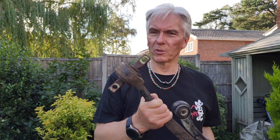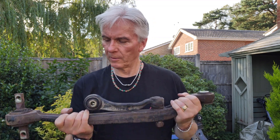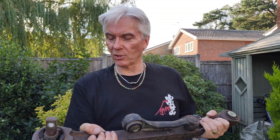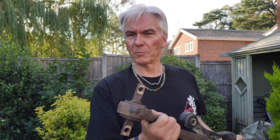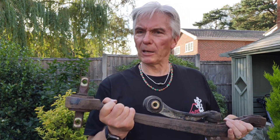Right, I spent a lot of time trying to get that out of the box! These are the other major suspension parts - the trailing arms - that bolt onto the chassis of the car and go onto the hub. The bush is excellent, no problem at all. The bush in the ball joint is fine, the ball joint itself is fine, the boot is still good on it. The only dodgy bit is that it doesn't move, but that's something Lee should be able to press in no problem - it's quite a normal thing to do. They have an alignment mark so you get them in the right position and press them in. I've got a pair of those, both exactly the same.